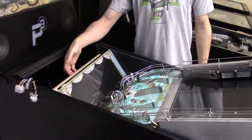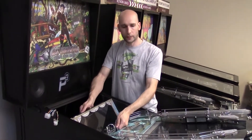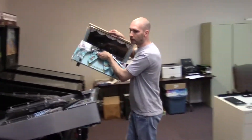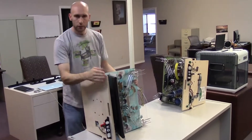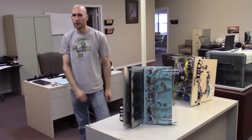I'm going to take one hand and put it in the handle on the back panel. There's another handle in the middle of the playfield — lift straight up and out of the machine. The playfield comes out. It's about a 20 to 25 pound playfield so it's not too heavy. It's safe to rest it on the edges of the wood here — it won't damage any of the components.